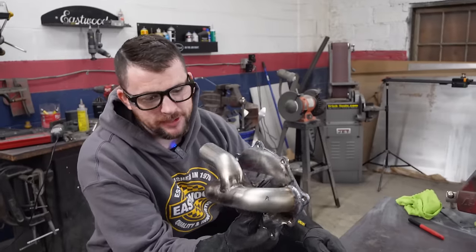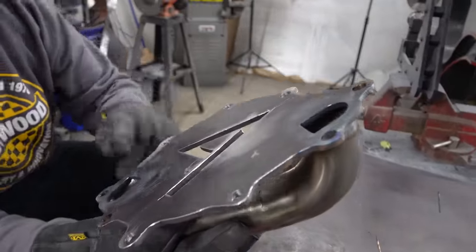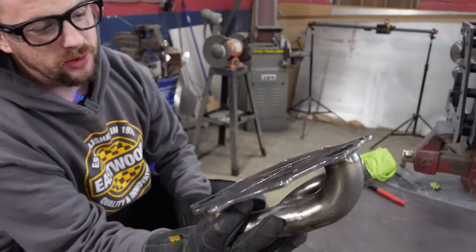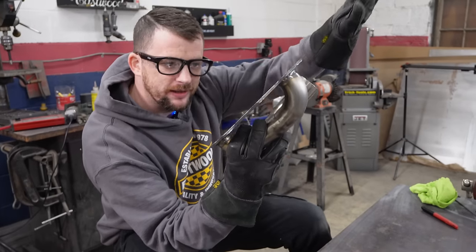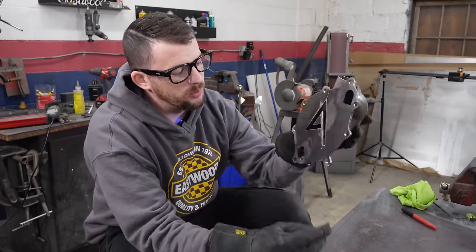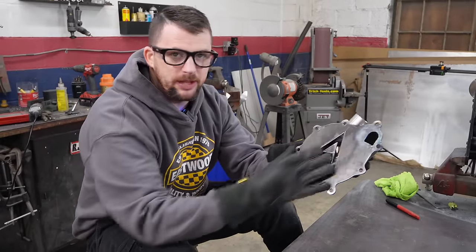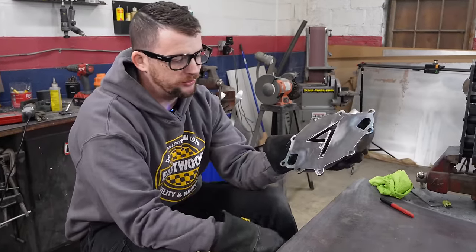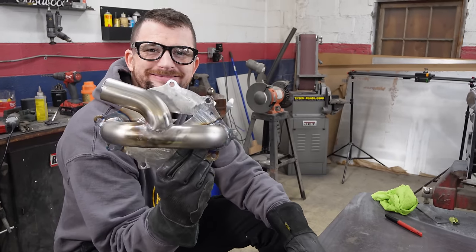So I got this all welded up now. We're fully sealed the whole way around. I don't see any issues. We have good flow on the inside here as well. So I think the next step is to make sure that this is a nice flat plane so we can actually seal against the engine block. Now, like I said, we're only worried about sealing here and here. So these two need to be exactly in the flat plane. This centerpiece doesn't matter at all. It's just for bolting and to hold our logo behind tubing you'll never see.